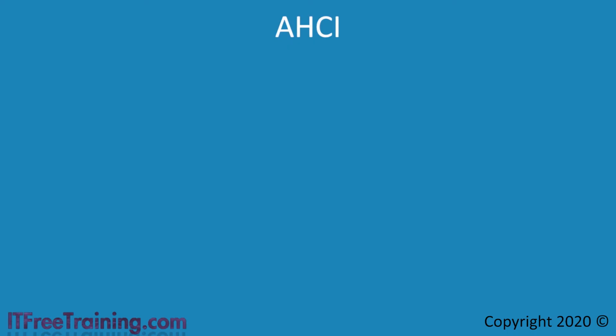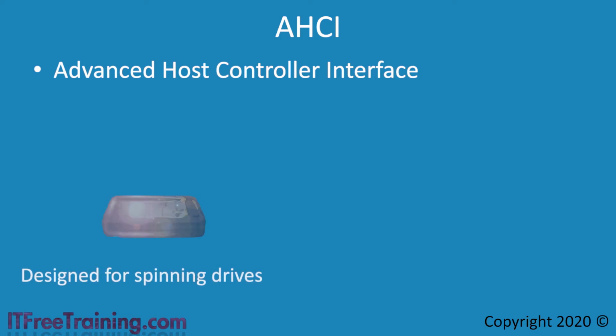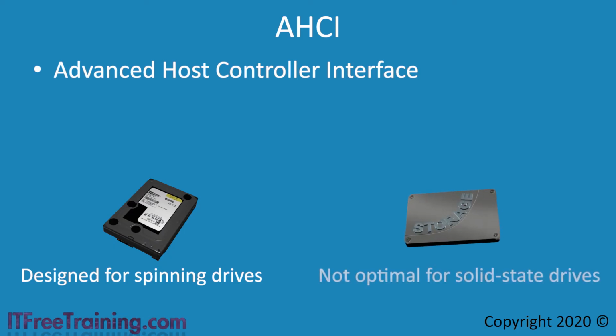I will now look at what controls SATA. This will allow us to have a better understanding of the limitations of SATA and why it is unlikely that you will see SATA 4 in the future. The standard that is designed to control SATA is AHCI, or Advanced Host Controller Interface. When it was created, hard disks were the dominant storage technology used, and solid state was not on the market yet. For this reason, AHCI was designed with spinning drives in mind. It can be used with solid state drives, however, it will not give optimal performance.